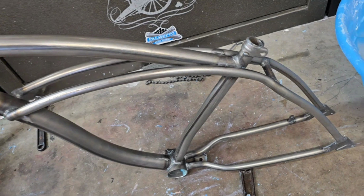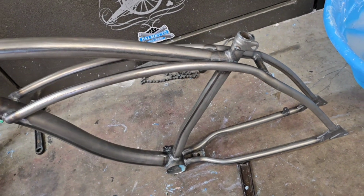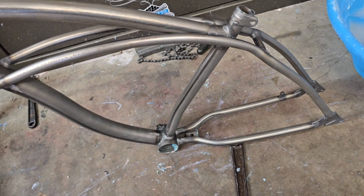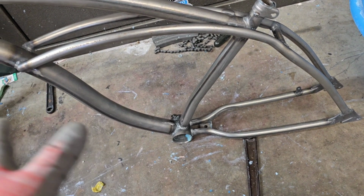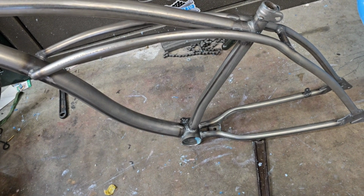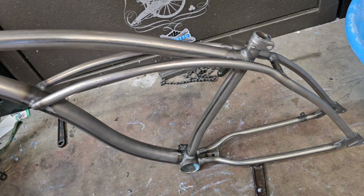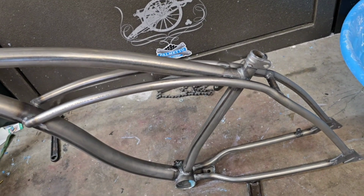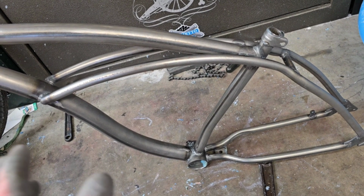Yeah, that's what it's kind of looking like. So it's looking good. The stripper worked, did its job. I'm going to explain a little bit more now, that the process is almost done. Pretty much I did one day, 24 hours, sprayed the first one, but before I sprayed it, I ran over it with the wire brush, you know, and just kind of scuffed it all up, got all the good stuff off, made it to where the stuff could penetrate easier.